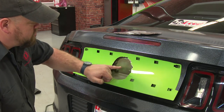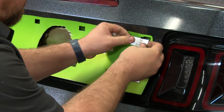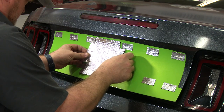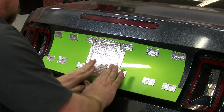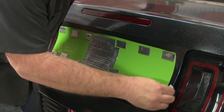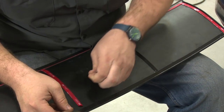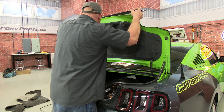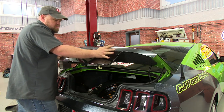The kit includes covers for all these factory holes here, plus the one we opened up. Grab the alcohol pad and just clean this area. Make sure you install these at least an inch away from all the edges, because that's where the panel is going to stick on. Now we're going to give it one more wipe with some alcohol around the edge — this is where the tape is actually going to stick. Then we're going to peel back all the red backing on the double-stick tape. You want to line up with the corners and push evenly across the panel to seat the tape.